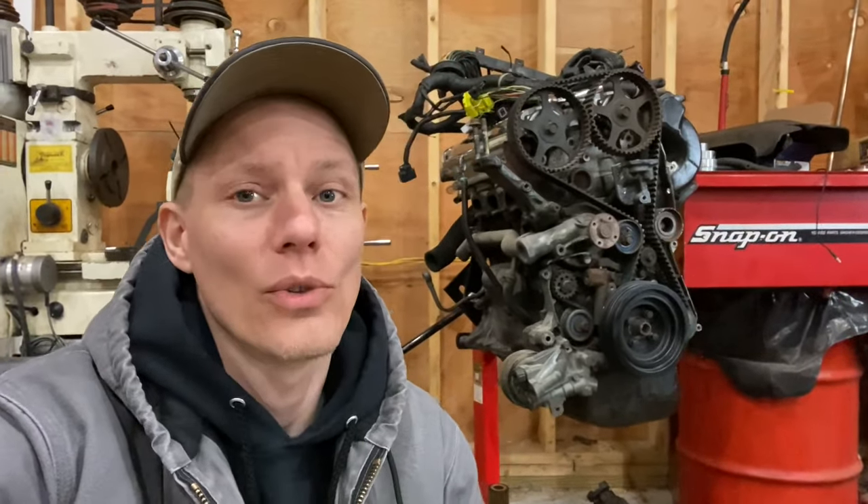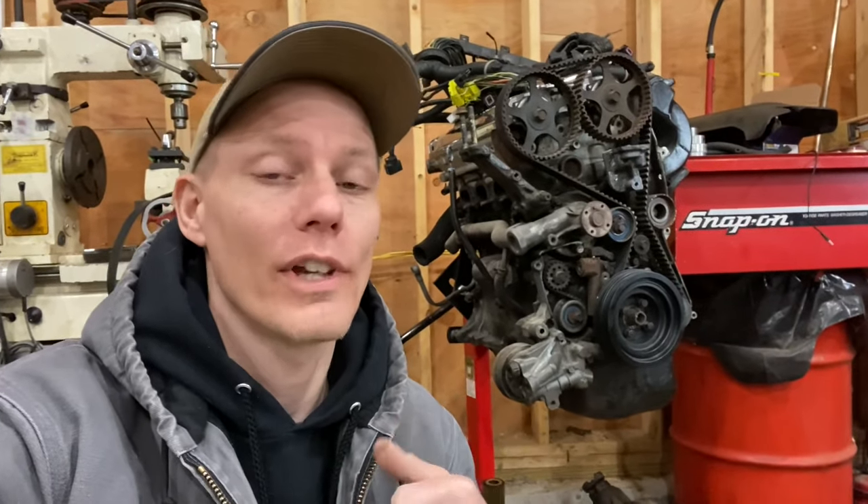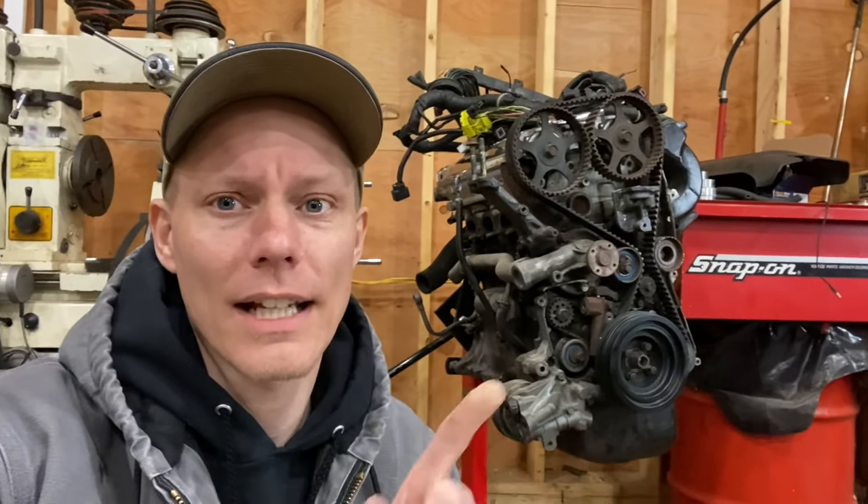As a recap: make sure you use wire that has a higher amperage rating than your fuse. Figure out how many amps all of your accessories are going to be using — whether it's a fan, a fuel pump, or a stereo system — figure out how many amps that's actually going to draw, then figure out the wiring and the fuse to go along with that. If you like the video, be sure to subscribe, ring the bell, leave a comment, like it, and share it with a friend.